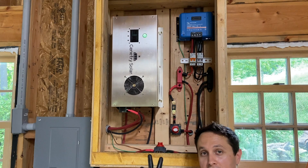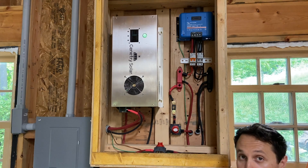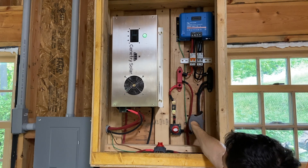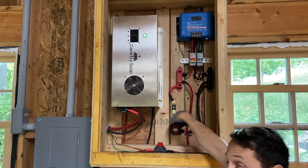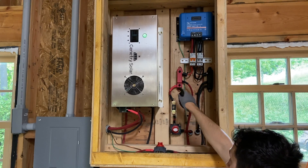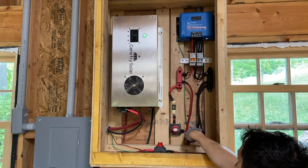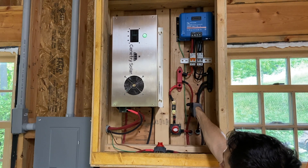I've got a pair of gloves — let's take a look at the actual electrical distribution system. The power from the batteries comes up and it comes right in here and it splits. This is positive, this is negative. This is the negative bus bar coming from the battery. The positive that comes from the battery goes to this DC disconnect switch — this isn't a circuit breaker fuse, it just allows me to safely disconnect the power from the battery. This is a 150 amp fuse, and then this is the positive bus bar. So basically all the power from the battery is coming up to the bus bar, but on the positive side I can disconnect the power and I also have my fuse.